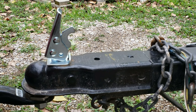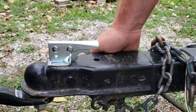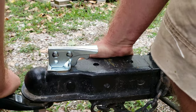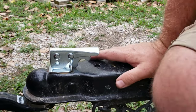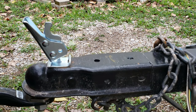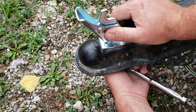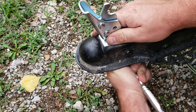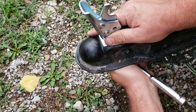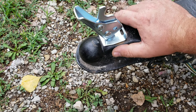When I get it on, I shouldn't be able to pick up and down on the hitch — it shouldn't wobble on the ball. If it needs adjusted, it's just a simple matter of dropping the trailer again, undoing the coupler without taking it apart, and just tightening it up a little bit more until you get the desired tension on the ball so there's no wobble. I've got it on the ball, on the hitch — simply going to close it. Mine still moves around on the ball just a little bit, so we'll undo it, drop the hitch, and tighten it back up. I'm going to go ahead and hook it back up one more time and give it a quick test, but I think we'll be good.